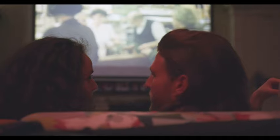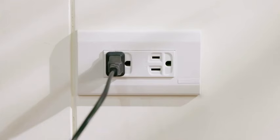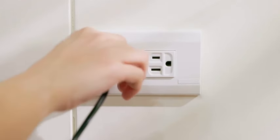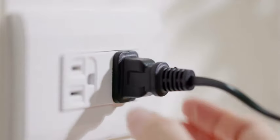Some of the things from this checklist might have already helped. But if not, here are 5 more steps to follow. Step 1: Soft reset your TV. Simply turn the TV off, unplug it from the wall, wait for 60 seconds, then plug it back in. This will most likely fix the issue, but if not, there are a few more things for you to try.